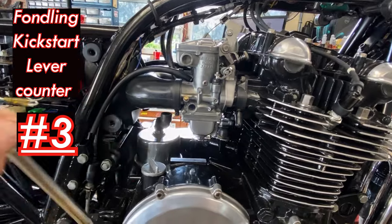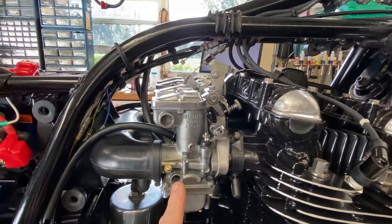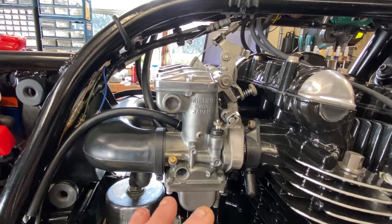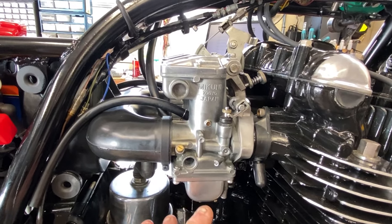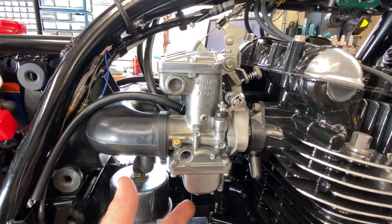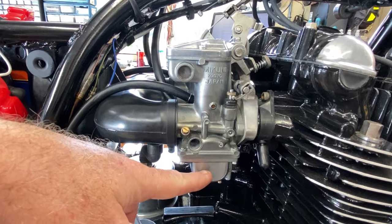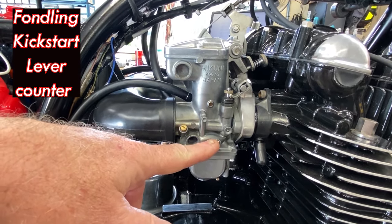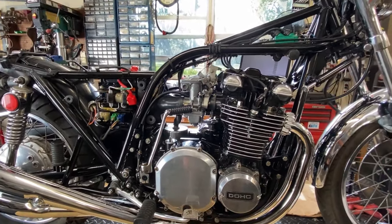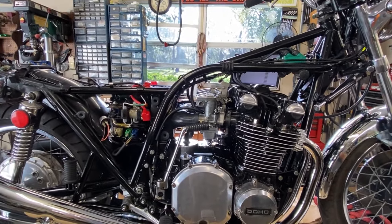I just had a feeling about it. The 25s on the slows are gonna be good — remember 20 is stock. As for my rationale: I can do the mains in situ just by taking the bung caps off. Remember 113 is stock, which I think is really lean for mains, and 20 for the slows. So maybe 120 and 25 will be the magic numbers. I'm going to hook up fuel and the battery and see how she runs.